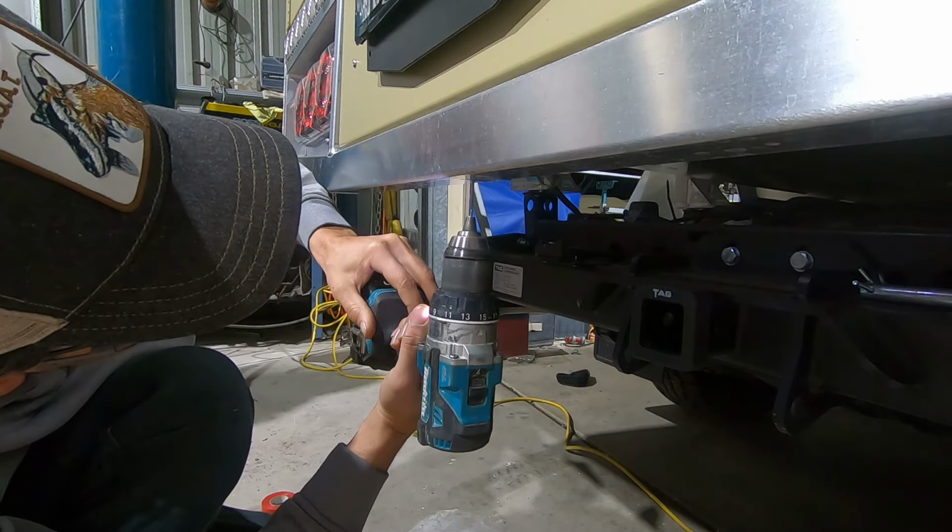The receiver, right? Once it's in there, you've got a flat surface all the way through. What happens with this one, and I've seen it, is this radius here, the camber in, that radius chews out the side of this and it elongates this hole. Ruins the thing. So if you want to tow for a long time, like towing a caravan, you're going to be doing a lot of kilometers with the trailer on. This little bit of movement and this thing rattling around, that radius chews that out.